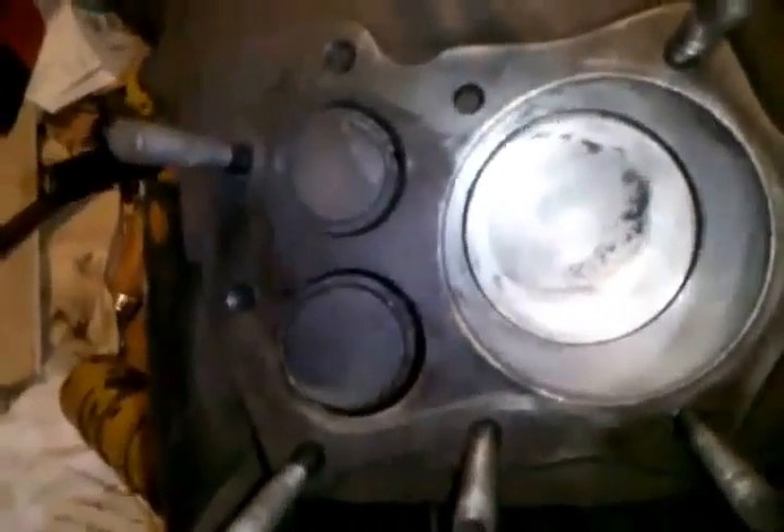This is sitting on my workbench. I'm going to turn it so you can hear it and listen. Did you hear that? Do you hear that little knock? I thought it was the piston hitting the cylinder wall there. But once I got that piston out and I turned it, I could still hear that clink. And it sounded like those little oblong things that push on the valves to open them up and close them — that's what it sounds like is actually making that noise.